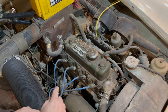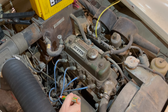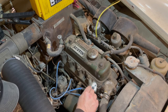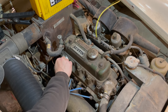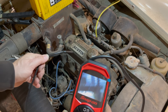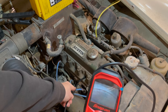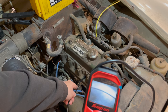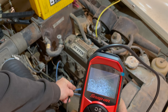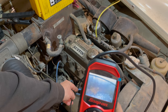In the meantime, I'm going to pull the spark plugs out and see if the engine will turn over. I do want to mark these spark plug wires before I pull them off so I can put them back the way they were. I'm going to take a quick look inside there and see what it looks like. The pistons and the bores actually look perfect still. I'll show you on my tiny bore scope — this is just a camera with a light on it that I can stick down inside the cylinder. That is the top of the piston, and the sides of the cylinders look like they are in great shape. It looks like this engine might have been running a little rich from these deposits on top of the piston, but I don't think that's anything to really worry about. The sides of the piston look in very good shape.